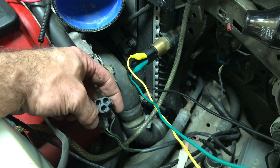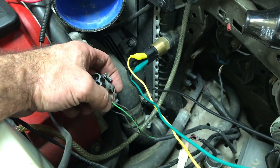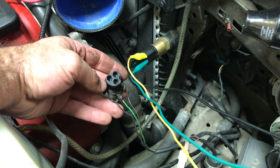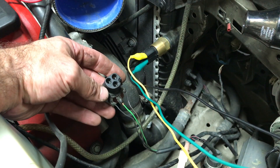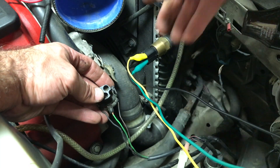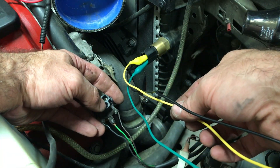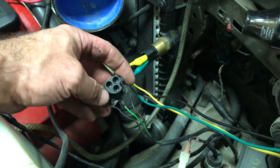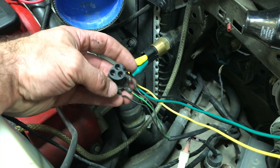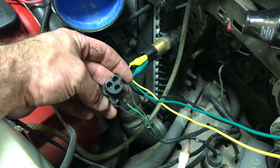Let's break for a quick interlude and take a look at the factory cooling system. I have a problem with the fan not coming on when the engine gets hot. The engine gets too hot — especially going uphill on the way home — and the car overheats by the time I arrive. I'm tracing it back to this radiator switch. It's a three-prong switch; I've got three test leads hooked up to it. The black one is the ground, yellow is low speed, and green is high speed. This is part of the factory E30 wiring that connects right to it, and it basically opens and closes to send signals to the low and high speed relays that then turn the fan low or high.